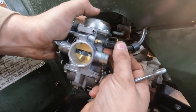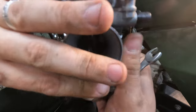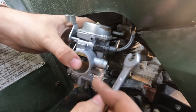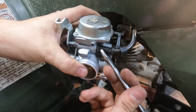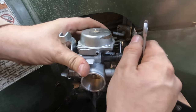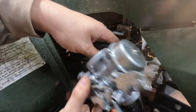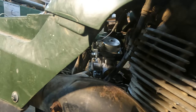I'm going to put the choke cable in there, then give my carburetor a couple of twists like that. I don't recommend doing that if you can reach yours with your fingers — I just had a lot of trouble out of this one. Take your wrench and just snug the thing up — you don't want it real tight because it'll break real easy. Put the rubber cover over it. Then snake the carburetor, get the fuel line out of the way, and snake the carburetor back up through the plastics and get it back in position.